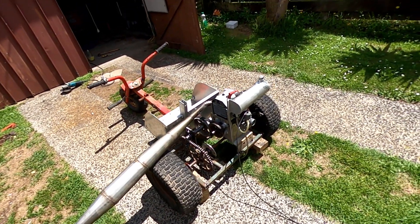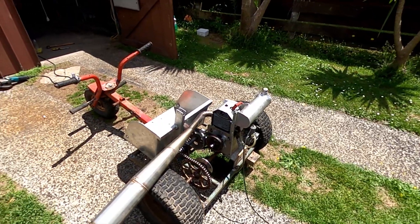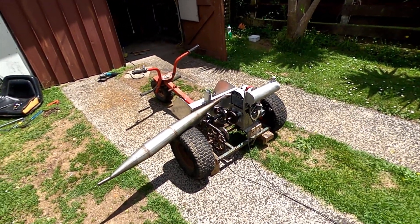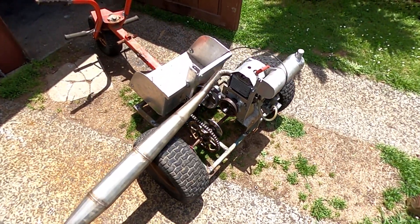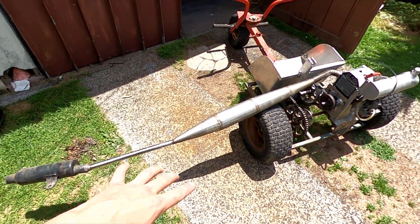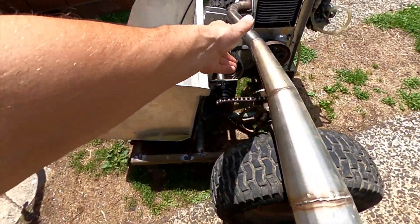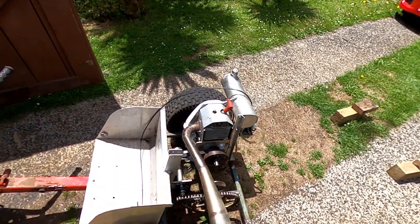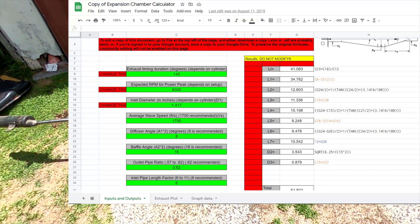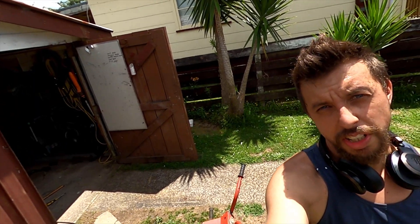As you can see it runs pretty good — you can hear it, it's powerful. I think they're about 19 horsepower, especially with an expansion chamber, so it's going to be a bit overpowered. It vibrated itself off the stands — everything's just sort of sitting together. Next video it'll all be welded off and hopefully a test ride will be going down. One last thing: I've got to make this expansion chamber fit in this buggy somehow. This is the right calculated length so it all has to fit in there. I'm thinking I could run it down this way, back around and up, or zigzag it along the back. Let me know in the comments. I'll also leave a link to the expansion chamber calculator so you can make your own. See you next time, thanks for watching!